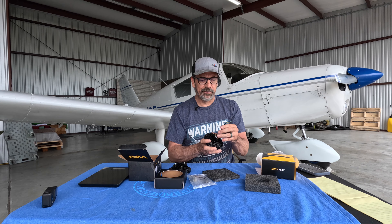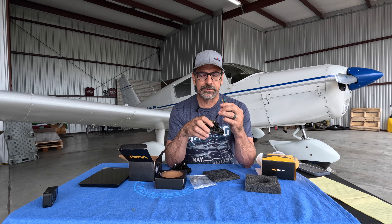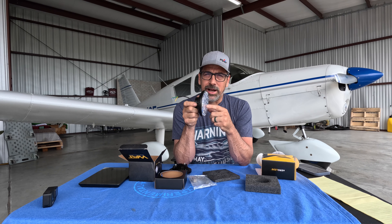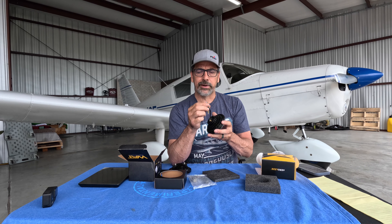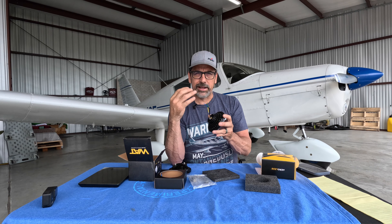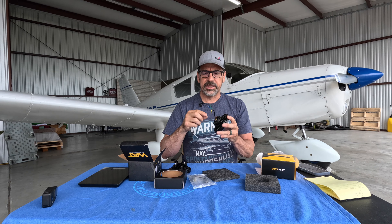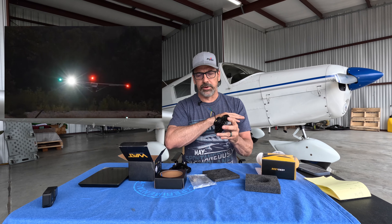It also has this additional wire harness containing a yellow wire, a blue wire, and a green wire. Not only is this a landing and taxi light, it also has a wigwag function. If you add power to the yellow wire, the light will blink on and off. If you have more than one light, that's where the blue and green wires come in — you connect the green wire on the left light to the blue wire on the right light, and the internals automatically alternate the two lights back and forth giving you the wigwag.